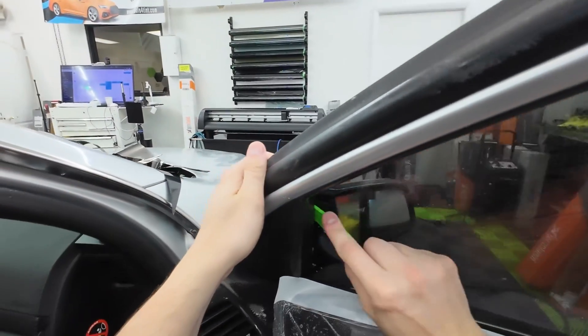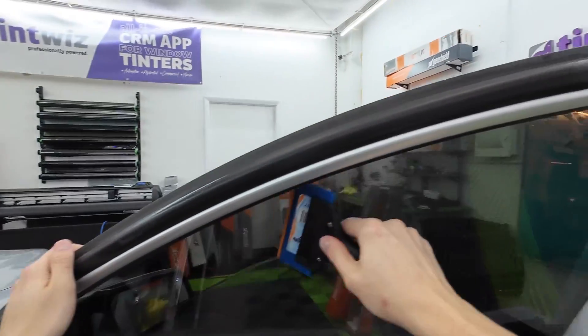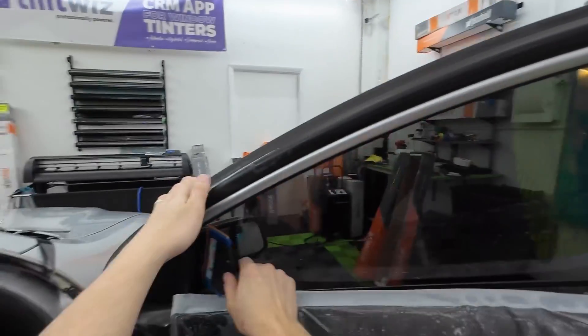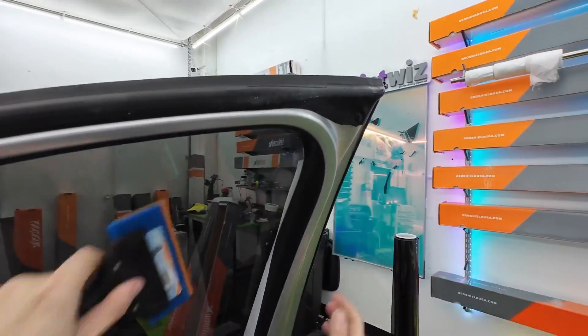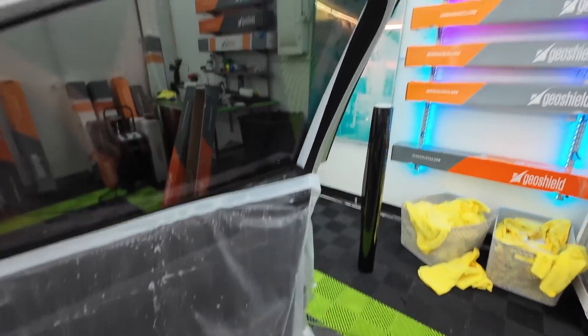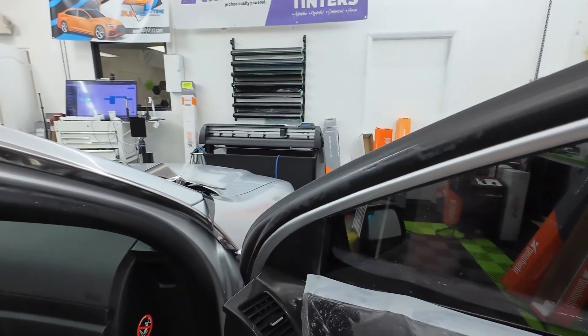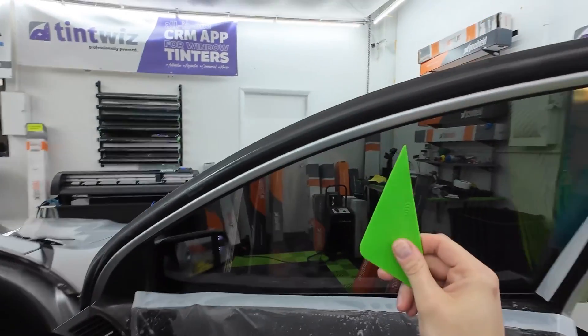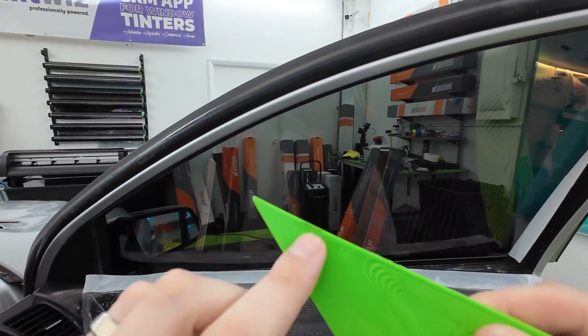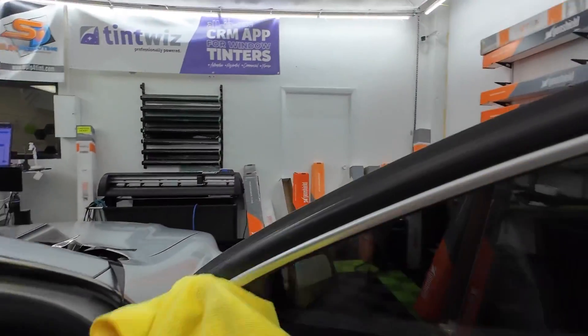Take this out of here. Couple firm squeegees across the entire thing — you usually see extra water collect from doing that. Just make sure everything's as ironed out as you can. Don't baby it too much, be really direct. Make sure your blade's clean and do that kind of swipe. One thing too — I always wipe my hand like that across the squeegee blade. See that little grime there? That type of stuff eventually will start wearing away your tools — it's just cost of doing business.